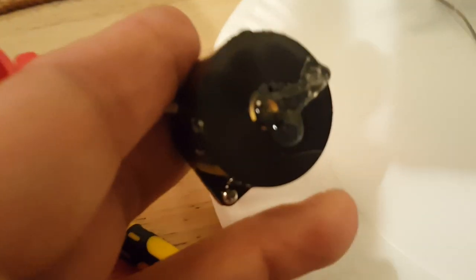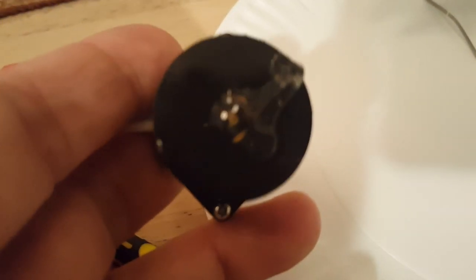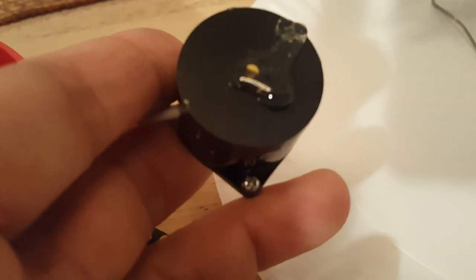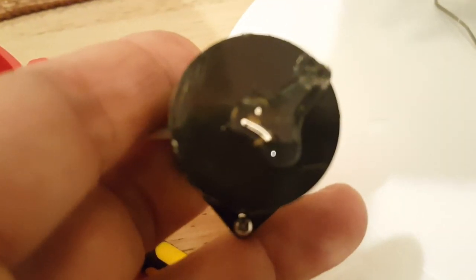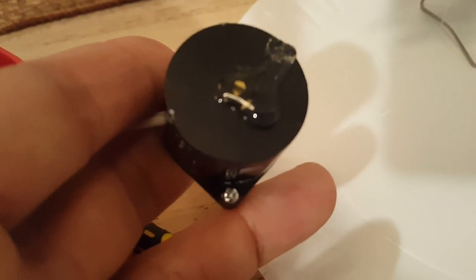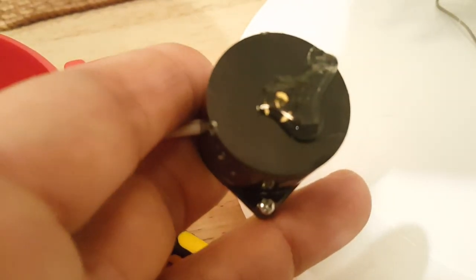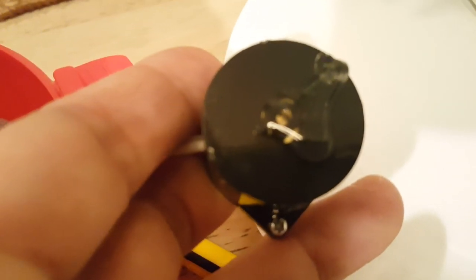Just like so — and that's it. I basically just dumped a bunch of hot glue into the buzzer. I have no idea if this is going to work or if I just damaged it beyond repair. I can trim it up after it dries. Hopefully this will stop the unit from vibrating — I've hopefully glued the diaphragm to the casing itself. The piezo buzzer uses the casing for amplification as well, so it's really challenging to silence this thing.